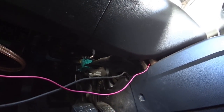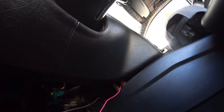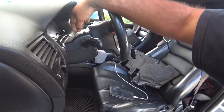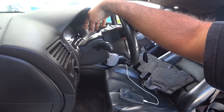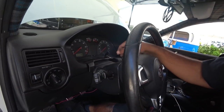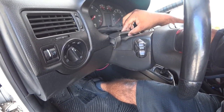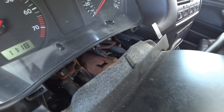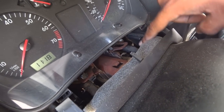Here it is — you can pull it all the way through and figure out the routing afterwards. Since I'm going to be using the steering wheel column cover, I need to take the existing one off and pop in the new one. You can see there's a little cover for your steering column — just pull it straight out. That exposes the underneath of your cluster, so you'll be able to run a rubber hose. I'd recommend running it through this side.